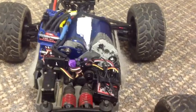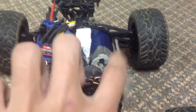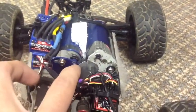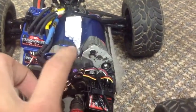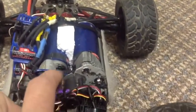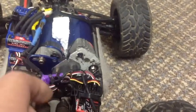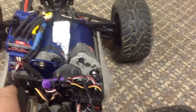What I did was I took some aluminum and this motor mount. I just laid it how it was on the motor mount — there was more aluminum because I cut out a piece from some aluminum. I drilled a huge hole where the spur gear shaft goes through, and then it attaches to the slipper clutch. I just bolted it to the back with the screws. It's kind of hard to explain, but if you want me to go more in depth I'll probably upload another video.